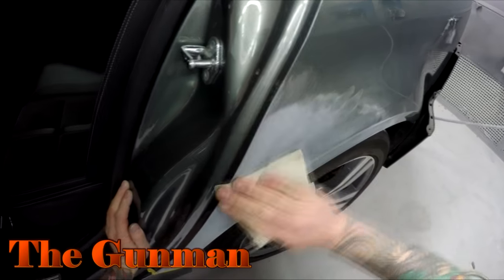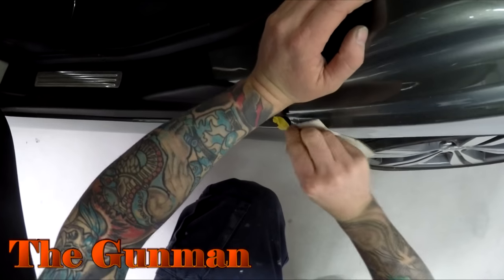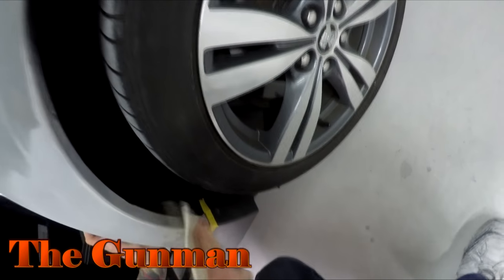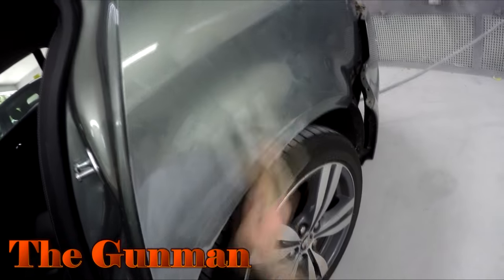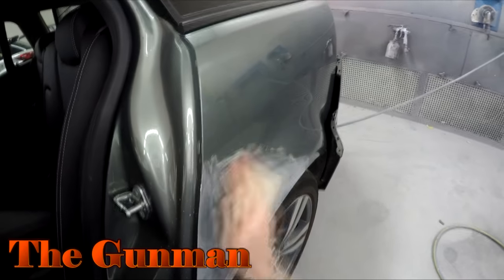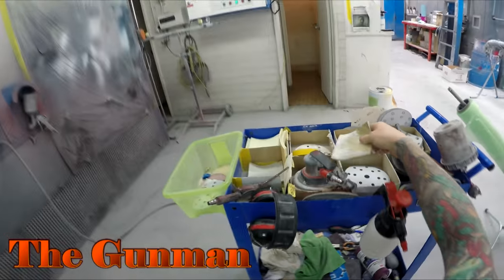Next up I gave it a blow off, then I've got a 400 grit soft back sanding sponge just to go around the edges. I was using 320 grit on the orbital sander. You could replace that anywhere between 400 to 240. I wouldn't recommend going much coarser than 240 because you're just going to end up ripping into that factory paint, and you don't really want that. Sometimes keeping it that little bit finer is best.